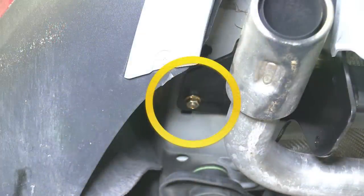Now that you have the carriage bolt pulled into place, go ahead and unthread the fish wire and put the hex flange nut on. We'll do this for both the driver and the passenger side.